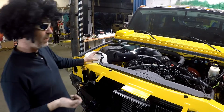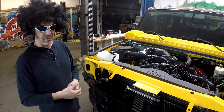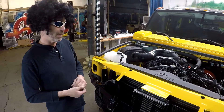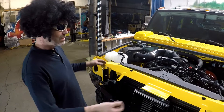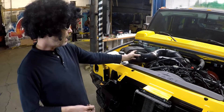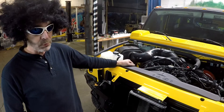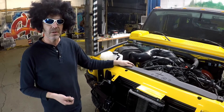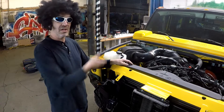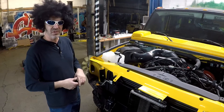On this one we've been doing something different on the intake system. For years we've done all kinds of intakes, and I've seen a lot out there with an open air filter under the hood. That's fine for a race car going down the quarter mile, but not a Hummer on the highway. The Duramax fan and hood seals create a static pressure underneath the hood, so everything becomes heat soaked. If you have an open air filter, you're just pulling hot air back into the engine, making it tougher to produce power. You create a thermal runaway — the hotter the air going in, the hotter the motor gets, which makes more heat under the hood, causing an overheating issue, loss of performance, and fuel efficiency in the toilet.